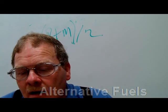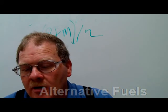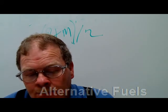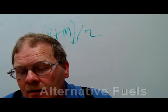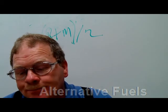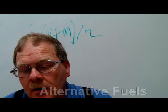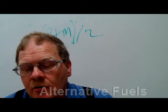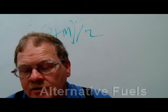Okay, a vehicle burning compressed natural gas loses how much power as compared to gasoline? That's question number 12. Got any idea? 10%. Got that? Well, that's not bad, really. You're going to lose 10%. In other words, if you've got 100 horsepower, you're only going to have 90 if you're using CNG, right?